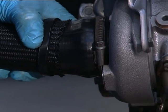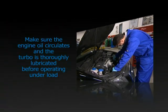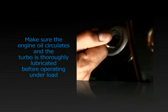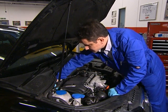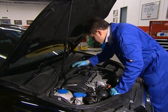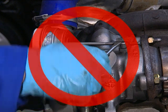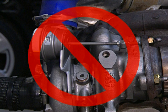Connect all other external fittings to the turbo. Make sure the engine oil circulates and the turbo is thoroughly lubricated before it operates under load — for example, by disconnecting the ignition system or fuel supply so the engine turns over on the starter motor without firing up. Check that the oil pressure warning light goes out. Reconnect the ignition or fuel supply and fire up the engine. Run it at a fast idle while you check there are no diagnostic fault codes or oil, air, exhaust gas or fuel leaks. If your turbo has a wastegate or is a variable turbine turbo, it will have been preset at the factory to suit your vehicle. Don't attempt to adjust it — this will compromise performance and void the warranty.